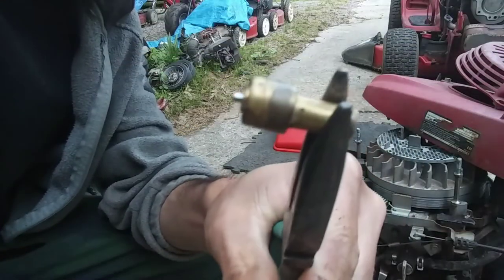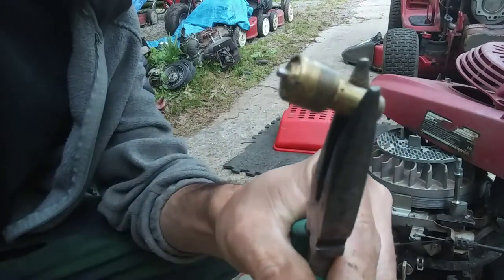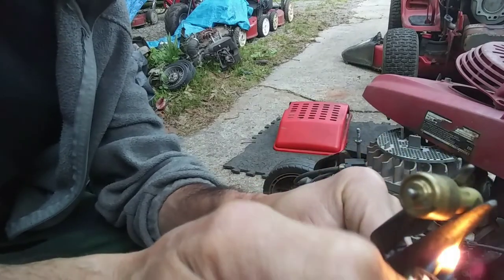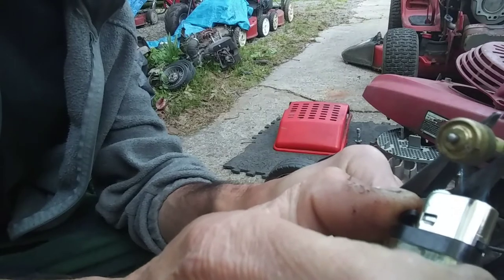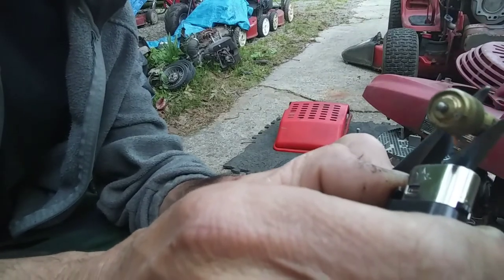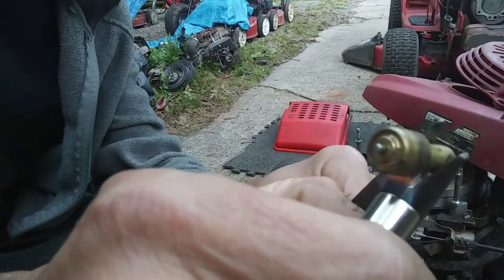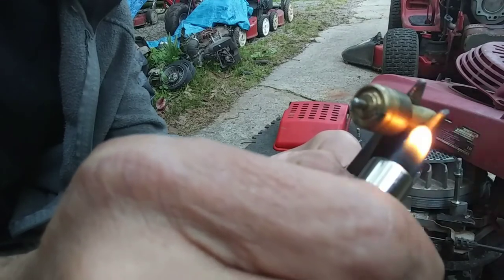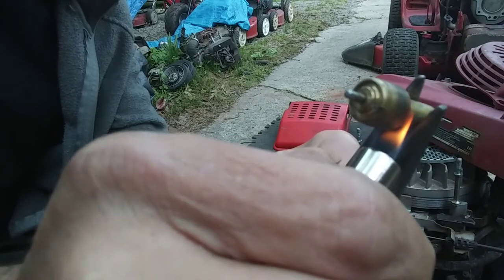See how this is how it should look when it's disengaged. In other words, the choke valve should be closed all the way. And if you heat this thing up, it's probably going to take a little bit, but you can slowly see it start pushing itself out. I may time lapse this, but you see there it goes. It's growing, it's growing.